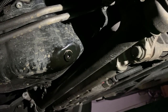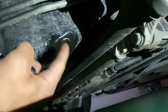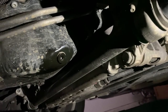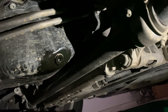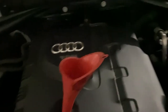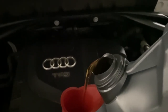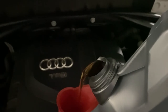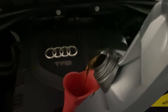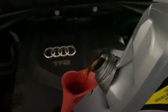Put the plate back on and you're good. What I'll do is refill the oil, let it sit for 30 minutes, and make sure I don't have any drips and have a proper seal. Use a funnel to pour the oil, make sure you're aware of the volumes to put in, and double-check your specification. Once it's full, run the engine hot and double-check the level inside the car — it will measure that automatically.